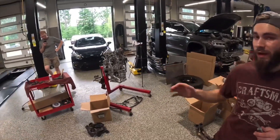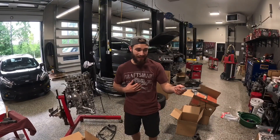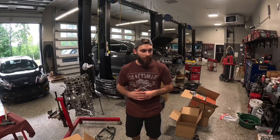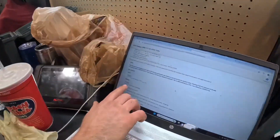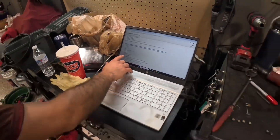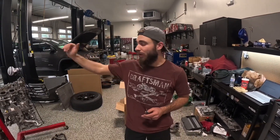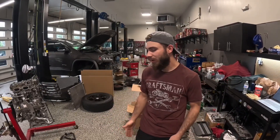After you install all your shims, recheck them and double-check that they are correct. If you have a shim that matches already, you can reuse it. The spec for exhaust is plus or minus 0.02 millimeters, so technically you could use a 216 or a 220 — but I would go straight for a 218 to be exact. I'm going to order them all to make sure they're exactly what I want, then recheck everything. And if you're wrong, you've got to do it all over again.